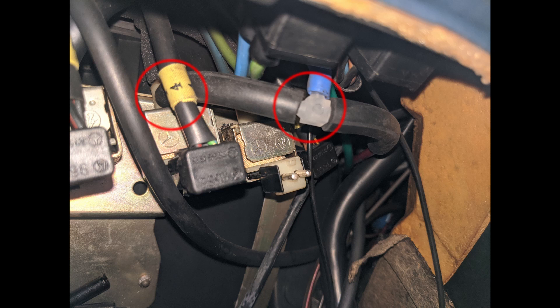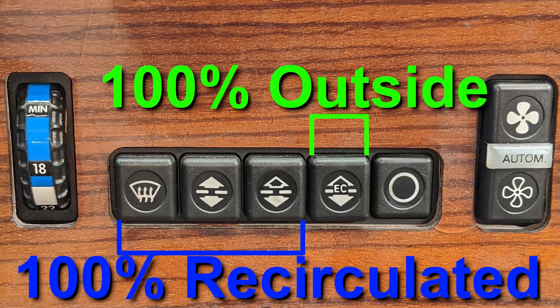Then plug that conglomeration of the tee for the green and red line into the top of valve number 4. Once valve number 4 is controlling those two flaps, in the economy position you will have 100% fresh air with no recirculation. If you set it to any of the positions where AC would be on — defrost, floor, and floor-and-defrost — the three positions to the left of economy, you will get 100% recirculated air, which will dramatically help your vent temperatures, especially when it's 90 degrees or more outside, because you'll be cooling air that's already been cooled once.